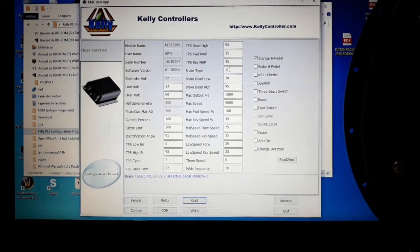The next setup is the brake type — same as the throttle type setting. If you use regenerative braking, you put zero for no throttle-based braking, one for a potentiometer, or two for a Hall sensor braking device. You can also set the low point for starting braking and the high point of braking, which applies when using an analog braking system.